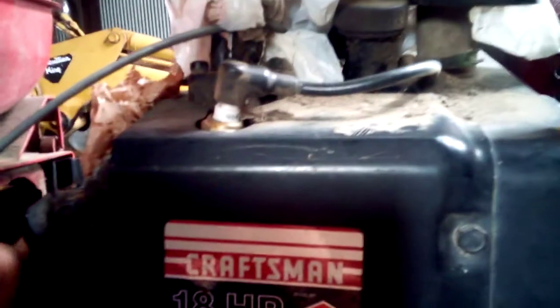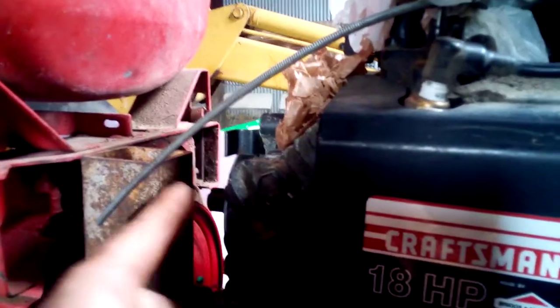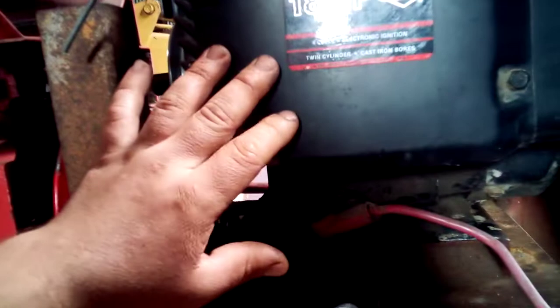So you got this pulley here. This one comes out to a jack shaft, which has these on it. And then there's one here. Sorry, I don't have a light right now. And basically small engine is small. I'm gonna say it's a 5 something, and I wish I could zoom out more. These two are 7, and then I think this one's about a 10. So it steps down to slow the RPMs, but keeping the higher horsepower for the torque.